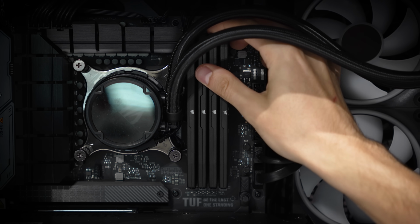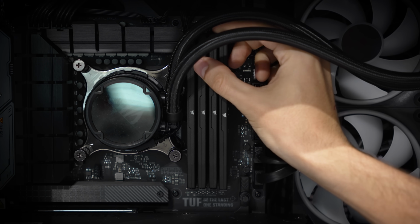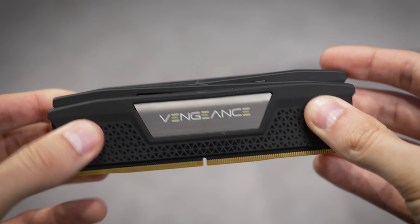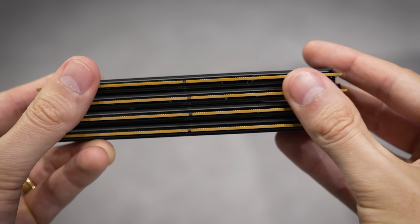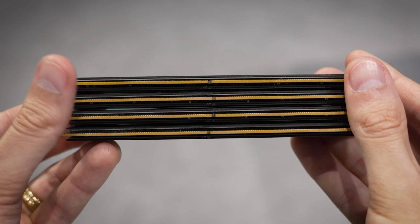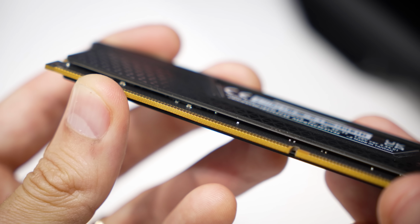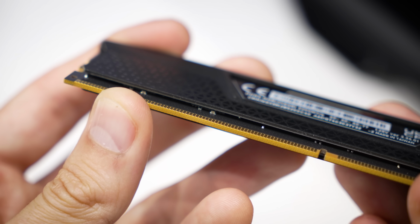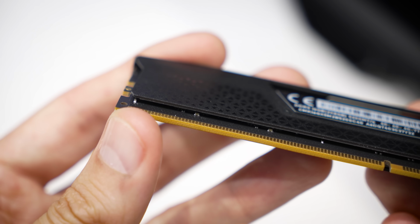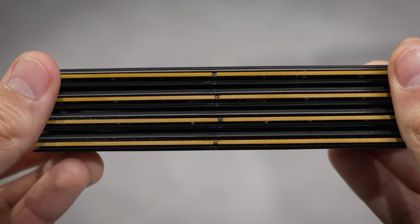I've got power cut. I'm gonna go ahead and remove every single DIMM in the rig, and we're just gonna start with one known working from my own stash. Physically, at least, these look to be okay. I've got them all four squished together here, and from this perspective, you can see on the top sides of each PCB, the SMDs that stack near the golden fingers. These can often become dislodged if any or all of them are inserted, let's say, incorrectly into the DRAM slots on the motherboard, and these all look to be intact. I don't see anything sticking out here. Doesn't look like anything is missing.